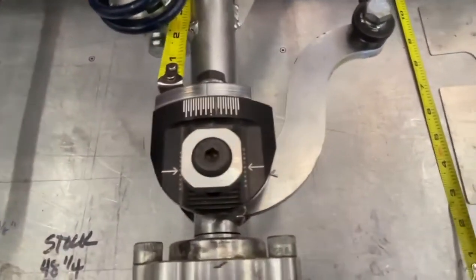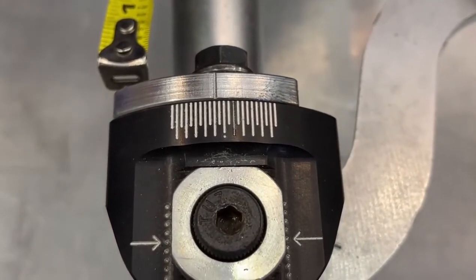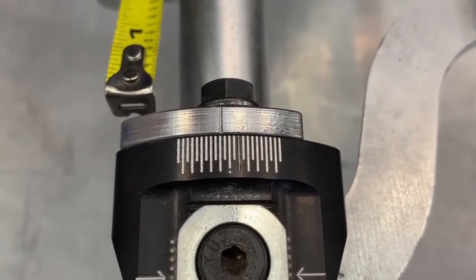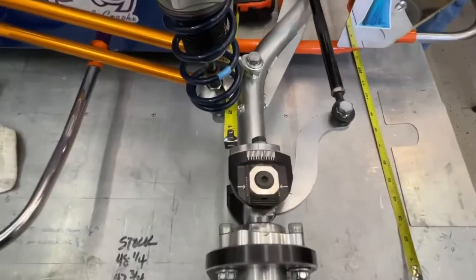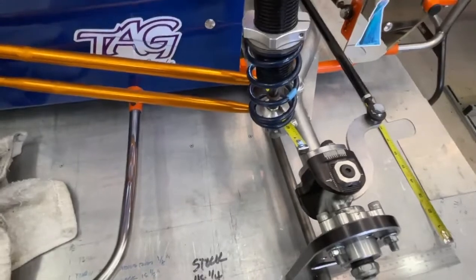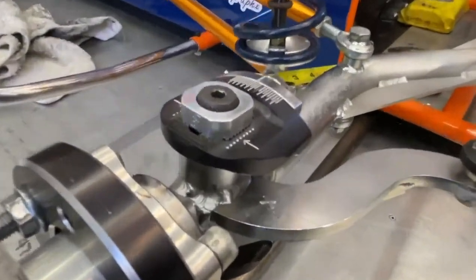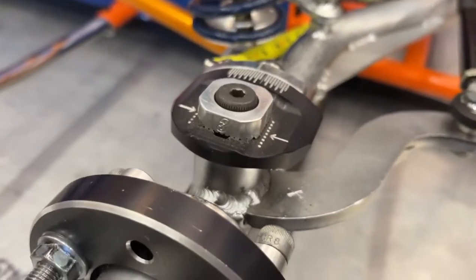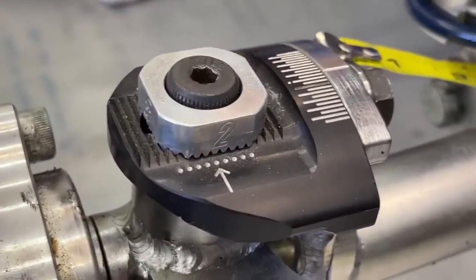This is the caster block right here. If you look at it, we call the one with the dot zero, and we call that two ticks back. So we like ours to be two ticks back, and then the other side will be zero - it will be right on the dot. And then for the camber, here's another one. This is how you adjust the camber - right here with this block, it's got little numbers on it. It's hard to read, but that says number three on this side, and this side says number two.